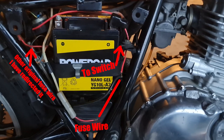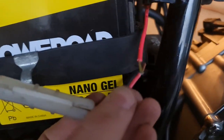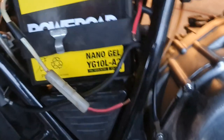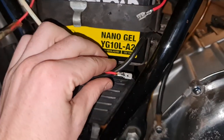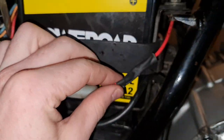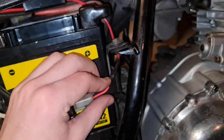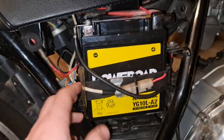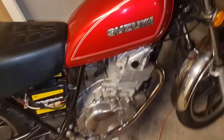I'll show you in a second. These two wires on the right will connect up — I'll be using spade connectors to do this. You could solder it, but I just think it's easy to use spade connectors. On the left side, we have the other original wire which I'm going to run up to the very top left — that is the other wire coming from the switch. So once these two are connected, the circuit will be complete and my hidden kill switch should be working. Here are two spade connectors for all the joins. I will be putting heat shrink on just to protect it, and I'll use my lighter again to do that. Now it's all finished — the join here goes from the fuse to the switch, and the other wire runs under the seat to the other side of the switch. They both go to the switch, and my hidden kill switch should be working now.